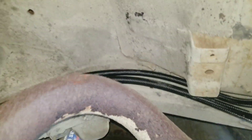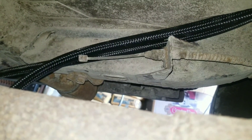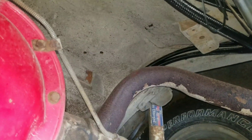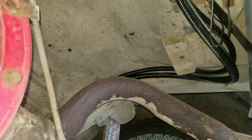I've got both my fuel lines - I want to run them to the passenger side. They're both running from here, going to run over there, following the frame rail. It'll be above my parking brake cable because it's not even connected - it hasn't been in forever. I will continue to run it along the frame rail until I get to the front where I plan on making a bulkhead for my fuel lines. Let me go ahead and get these fuel lines situated and tied up to the front. I also got to put a fuel filter in - probably right there along the frame rail.